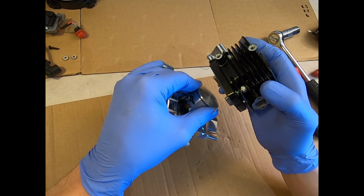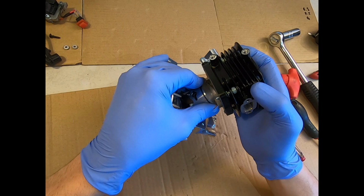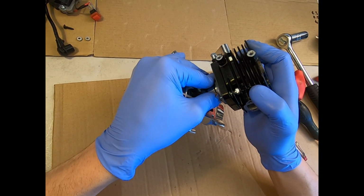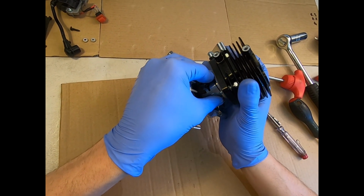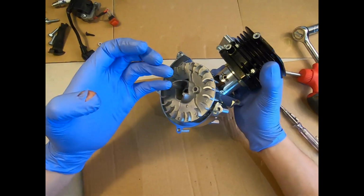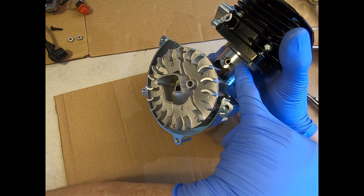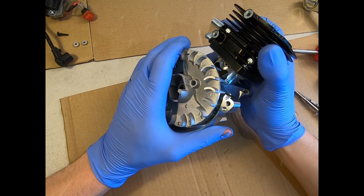I'm going to bring the cylinder over it, and the tapered edge of those two locating lips are going to come on sideways and just start to take hold of the ring and take over from your fingers. So as you're gently putting it on here, the tapered piece of the cylinder has taken over from your hands. The ring is now pinched. Check at this point that you don't force it on incorrectly. The gap is in line with the peg, and then just gently shimming her down.